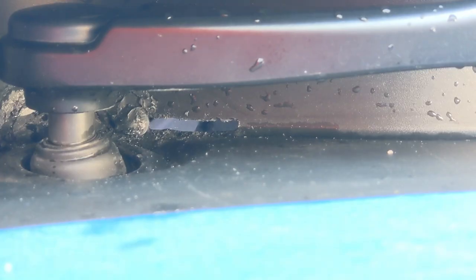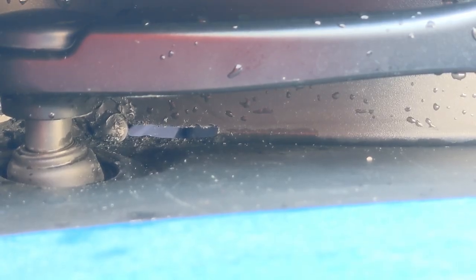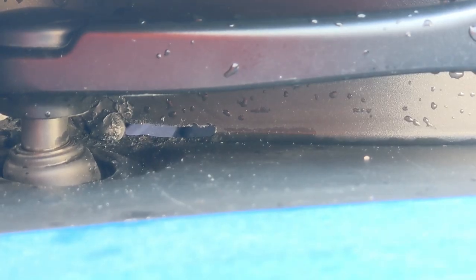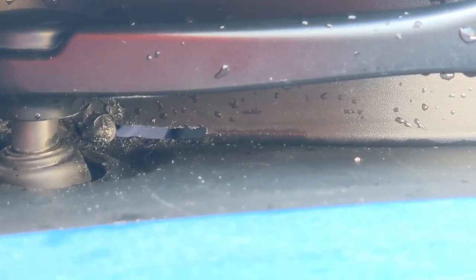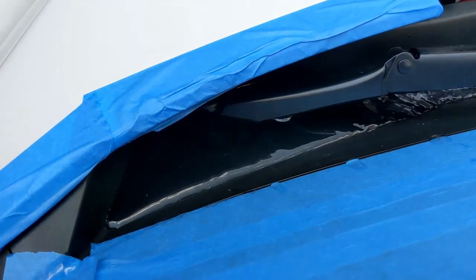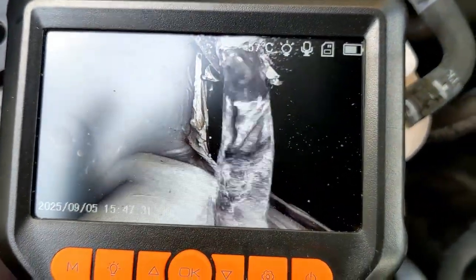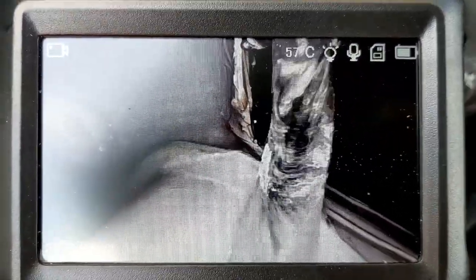The distance inboard needs to be an inch and a half, otherwise it still somewhat spills onto that little seam underneath. At this point it's in good shape with no problems — it's not draining laterally — but the cowl can still overflow with heavy rainfall, which probably doesn't happen that often. There's probably a point of diminishing returns in making it massively large. In the water cowl test, the water fills up the side of the cowl and spills over, but the good news is it appears not to go out laterally — you can see the new hole right there, falling to the inside.